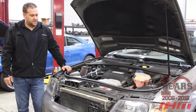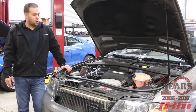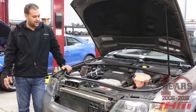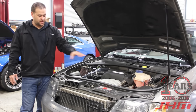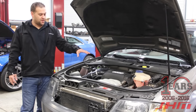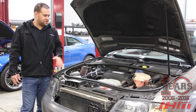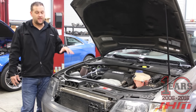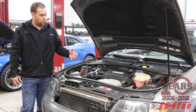Now I'll go into the specifics of this car. Unlike the earlier A6 timing belt-driven engine, this engine is basically a B6/B7 S4 engine with a couple of mild differences to make it work in this car. The car overall is going to be the same as a 2.7T all-road, which is what most people are used to. The big difference is the engine — the fuel system differs from the B6/B7 S4 in that it has actual return lines, basically the same fuel system as a 2.7T. The B6/B7 S4 only has one fuel line coming in with the return system in the rear. We also found the AC compressor is not interchangeable due to some line differences.